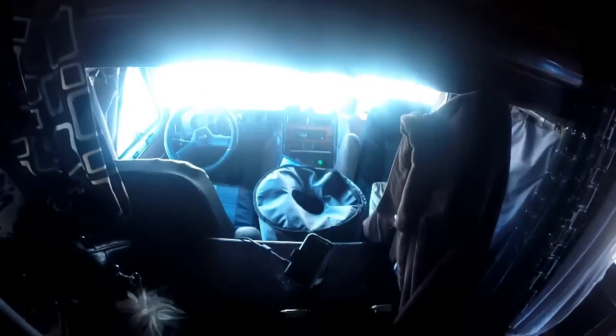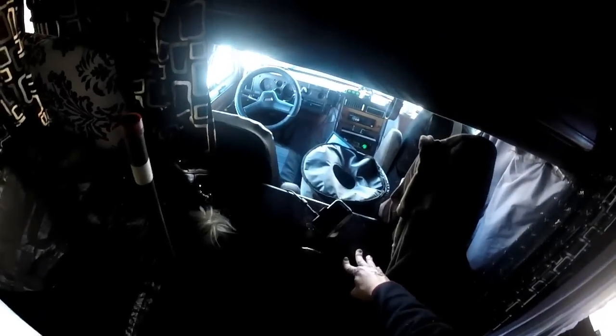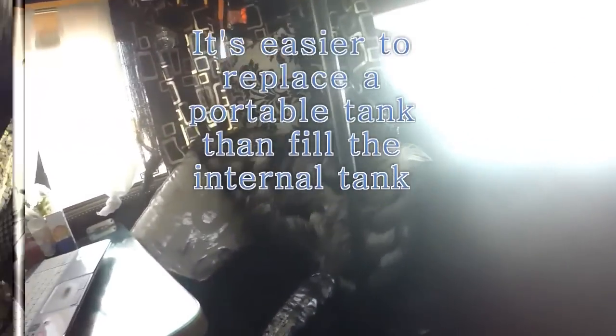Carrying on — you've seen the driver area. This is actually a cabinet I added in, and this is where I store sweaters and stuff. And this is my buddy heater. I have a line running — it goes back behind this cabinet, underneath this cabinet, and then down into a compartment outside where I have a 20-pound propane tank that I can replace really easily. And this really keeps me warm.